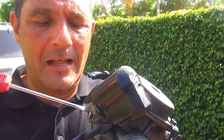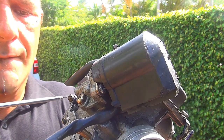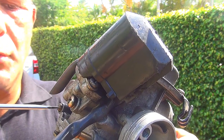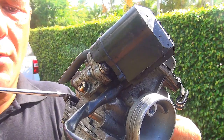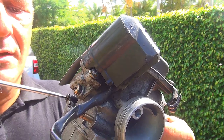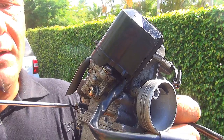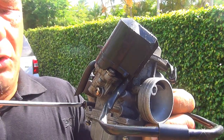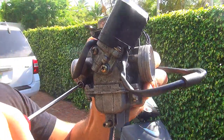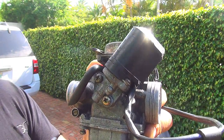This is a flat screw — place the ring right there and put it in gently, because these screws are made of brass and can be damaged if you apply too much force. Make sure you use a nice flat screwdriver. This screw is located on the left side of your scooter. Turn it in snugly but not too tight.